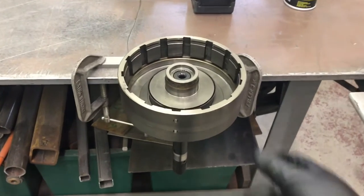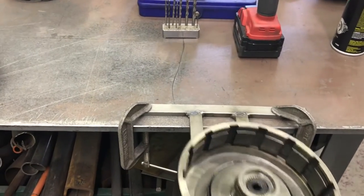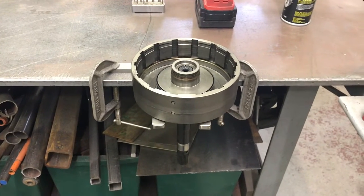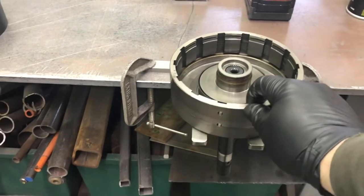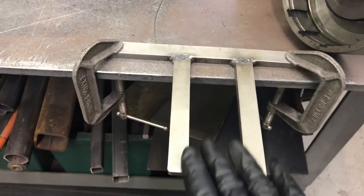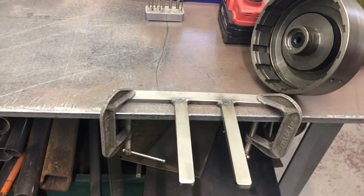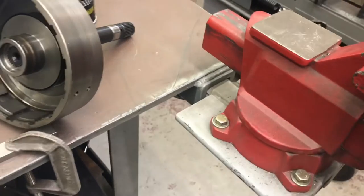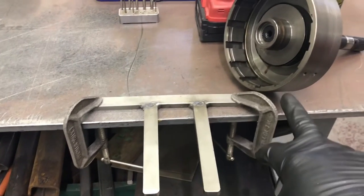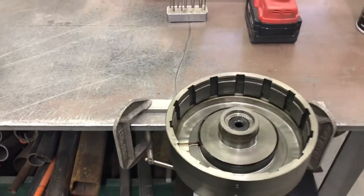To service the forward drum, because it has the input shaft attached, you either need a hole in the bench — which leads to oil running through the hole — or I made this simple fork arrangement and it dangles like that. The drum spring compressor mounted to my vise is also slotted so this fits in nicely. As an unplanned bonus, my lower unit slides right on here and I can stack it up. I can also use an old bolt-on yoke welded to two-inch square tubing that slides into my vise. Super handy, just clamps to my bench, and didn't cost much because I built it out of scrap.